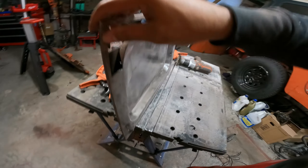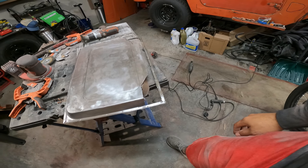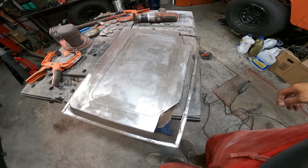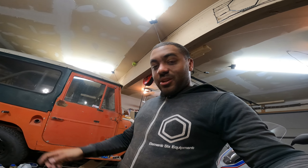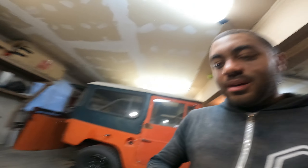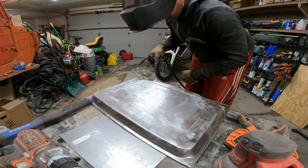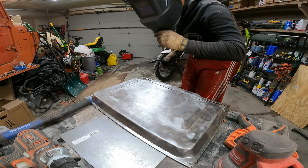We now have a mostly clean door that I need to fix up - so yeah, that's the game plan. I've got some 22-gauge steel, same thickness as this stuff. I'm going to see about hammering some of the bends out and then try to box in that little area. I'm going to try to cover up some of these slash marks that I made, and once that's done I'll put some rust reformer on it.